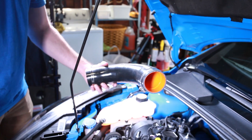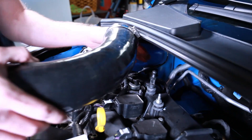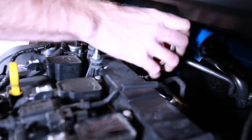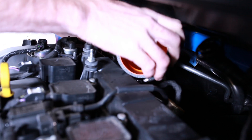I'm going to take a quarter-inch drive with a number seven millimeter socket and put it down there on the turbo. Be careful going down here because you don't want to drop anything into the turbo — that would obviously be bad. Just kind of press the pipe down on there, feel around, and you should be able to feel right where it goes.